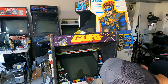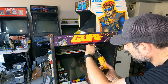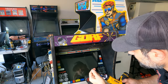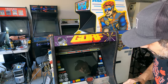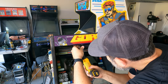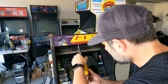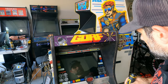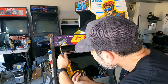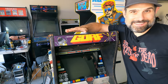You've got to be careful with these acrylic things — you don't want to crank it down so hard that you crack the acrylic. So just be careful when you crank these back down. It looks good so far, definitely looks a hell of a lot better than it did. Make sure your screw gun torque isn't too hard here, because it'll crack the acrylic like I said. So when it gets to the end, we'll just hand screw them in. It looks so much better than it did — I'm stoked. It looks pretty good. I think this looks nice.